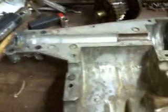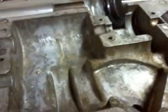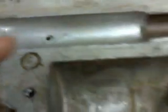So anyway, that is how you get your shifter plate back in place if your screws don't want to move, or if you just plain don't feel like messing with them. And if it's a grease transaxle, make sure if you've got felt washers or neoprene, it doesn't matter, to put them in place. And if you're going to convert it to an oil transaxle, make sure you plug these holes right here. Now, there's no grease zerks on them. You'd think there would be. These holes right here, you leak out your oil right there, and you'll be wondering, what the heck? So make sure you put a plug in there. Screws or whatever. Or heck, if you can find a small enough one, you can screw a grease zerk in there if you wanted to. Just try not to grease it.